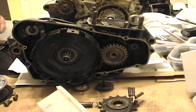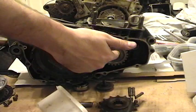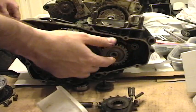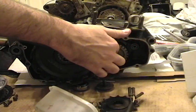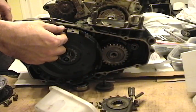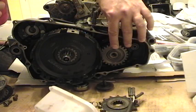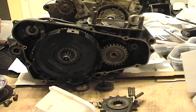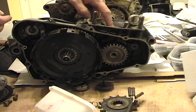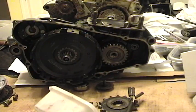For example, let's say the gear ratio is two. This little gear has to rotate two times to turn the big gear one time. So if this gear is turning at 4,000 RPM, this gear is turning at 2,000 RPM - you take the RPM divided by the gear ratio. Now torque is the opposite: we take torque from the crankshaft and multiply it by the gear ratio, so torque is actually multiplied as you go through the drivetrain.